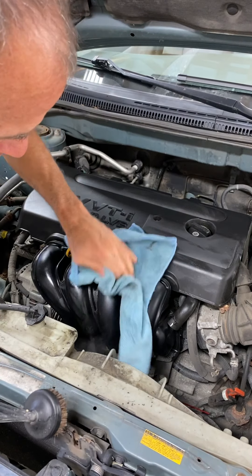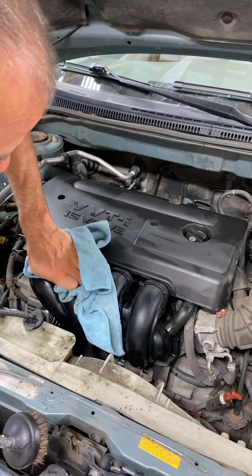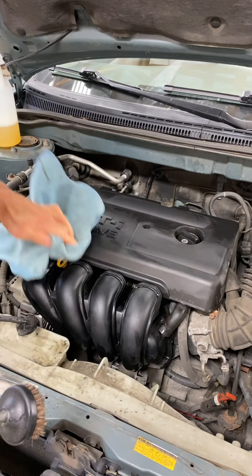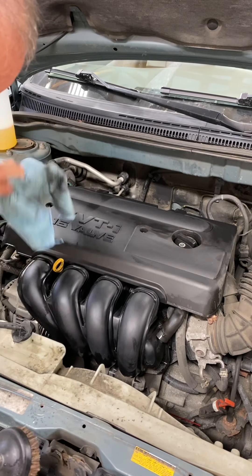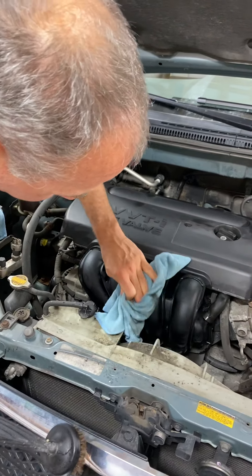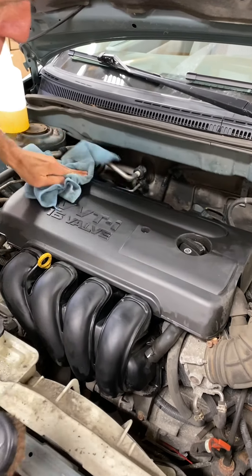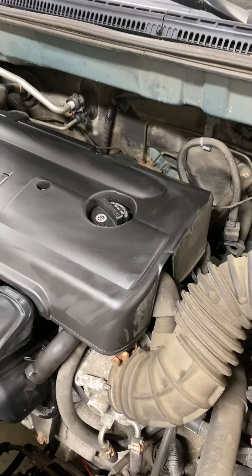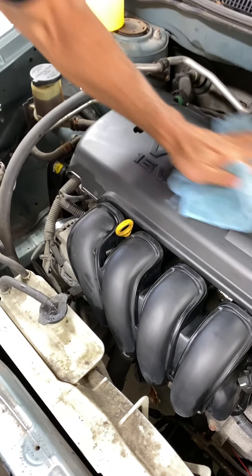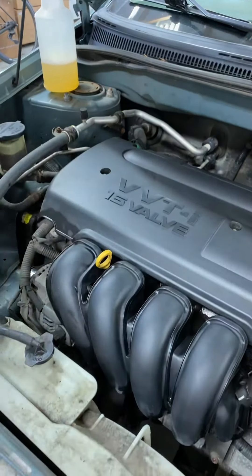I was on the steam for a considerable amount of time. The way I like to see you use the steamers: don't fall in love with what the pressure gauge is reading — I know I have enough steam to use. So there's our intake manifold, there's our valve cover — it's fairly clean now, though probably not as clean as if you used a pressure washer.